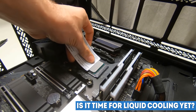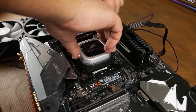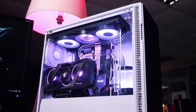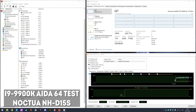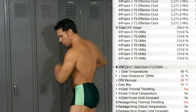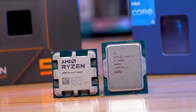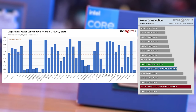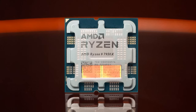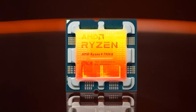Processor installed, a thin layer of thermal paste applied, it's time to install a coolant system. But what kind? A few years ago, we would say that there is no place for a liquid coolant system in an ordinary PC. It really was so. Most processors, even top-end ones, were not so hot, and getting a water cooling system was a waste of money. Now everything has changed. Intel's competition with AMD, as well as the inability to keep shrinking the process node as much, led to the fact that 200-watt processors are not only the Core i9s now, but sometimes even Core i5s. AMD is even worse. Because of the chiplet structure, 8 hot, fast cores are located in a small die, cooling which is not a trivial task at all.